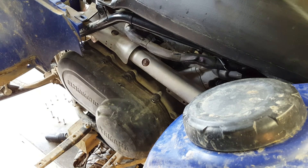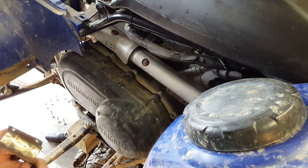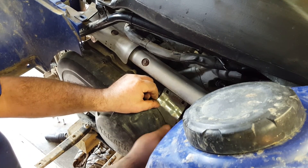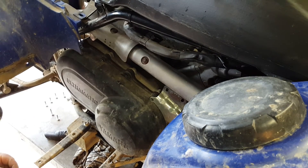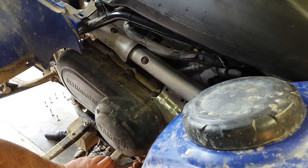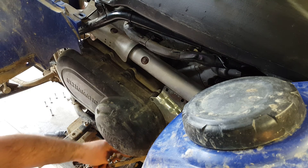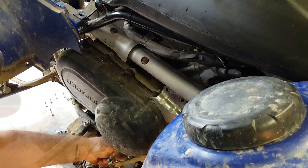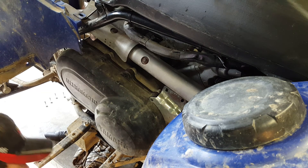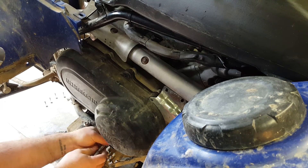I'm going to put copper paste on all of these bolts when I put them back in again. The reason for that is, in the past when these bikes get a little bit older, these are the kind of bolts that tend to seize up and cause you problems, especially if somebody over-tightens them. So we'll just pop them all in for now with a bit of copper paste and whiz around with the extension bar. And whoever works on this quad bike next time, because it might not be me, will be very grateful that there's a bit of copper paste on these bolts — it makes their life so much easier. And by putting all these bolts in order on the bench, we're not messing around trying to find the right bolt for the right depth of hole. It just speeds everything up. It should be easy, not hard.